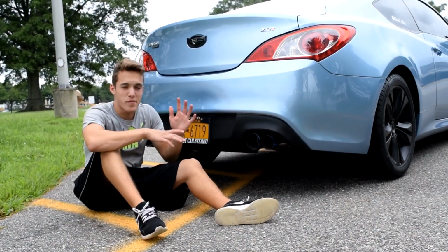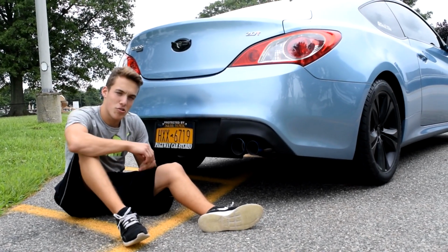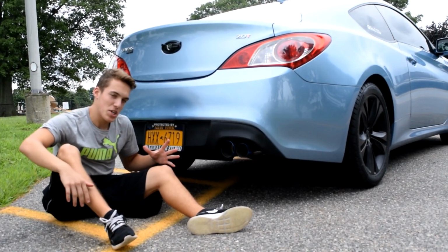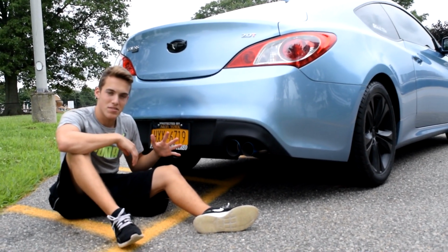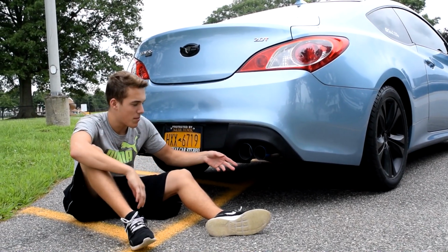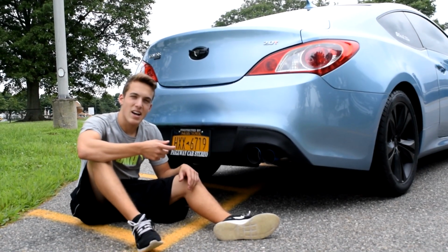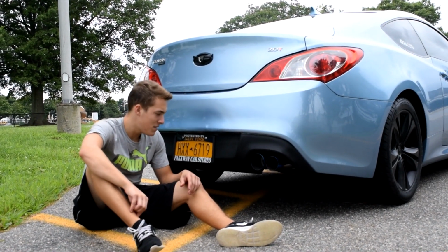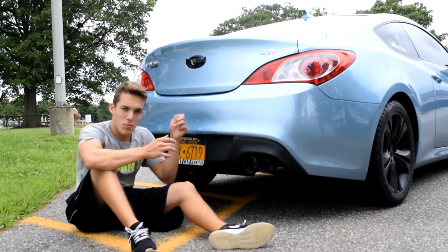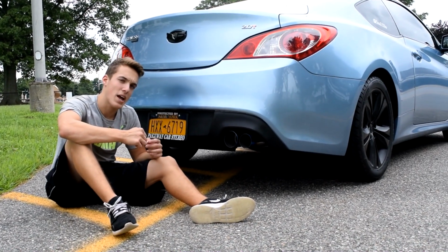So my exhaust is fully on. Everything's bolted in, all up on the hangers. And when you guys are doing your exhaust, make sure you don't put the whole exhaust together when it's outside your car. Put it all in separate pieces. So I would recommend work from your cats back to the exhaust tips. And when you put them in, just put the bolts on like hand tight. And besides that, once they're all in, hand bolted, put them on the hangers, because having them not tight will allow you to have some leeway and movement while you're putting them up on the hangers.